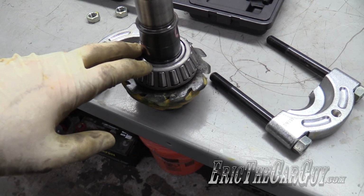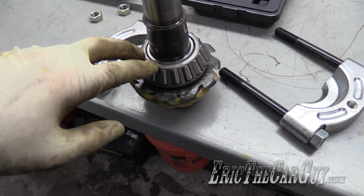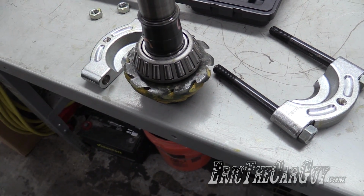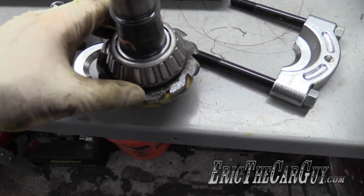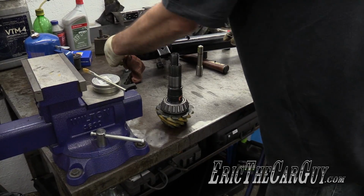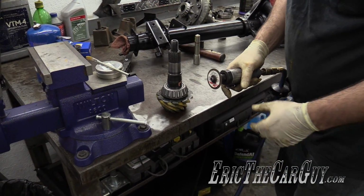With that being said, I called the Ford dealer and I believe they have one in stock, but I have to get this off of here and get the number. This is why I said, get 2 of these bearings, hollow one out like I showed, and you'll be able to slip it on and off to do all of this setup work. And then when you're ready for final assembly, you'll know what pinion shim to use, and away you go. Got all the important bits sealed off on the axle on the table here, so don't yell at me.